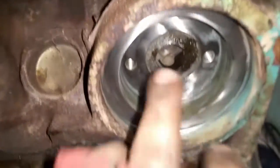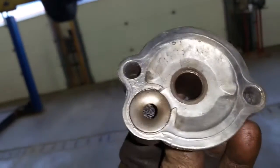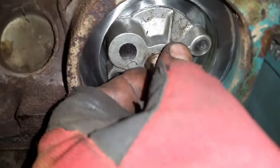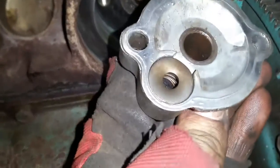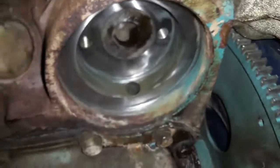For the oil filter, I'll grab the piece for that, which looks like this. If you notice, there's a ridge that goes all the way around — these aren't really meant to be used with gaskets. So what you do is get that up in there with a little bit of Loctite on the bolts that hold it. You torque that in place, and it's not meant for a gasket — it's meant for that little aluminum ring to crush a tiny bit against the metal and seal right up.